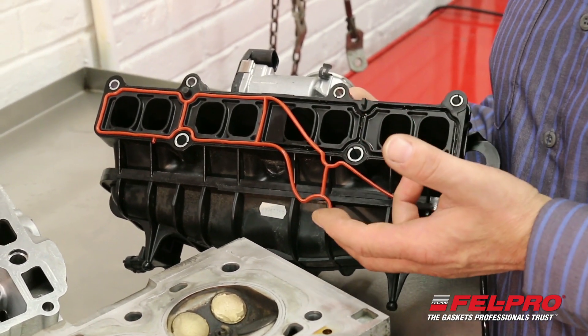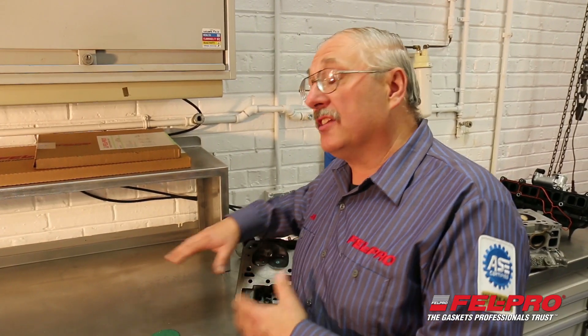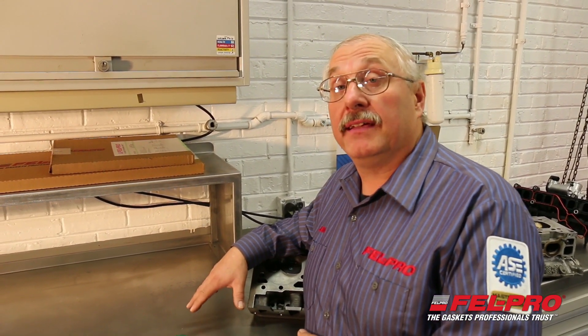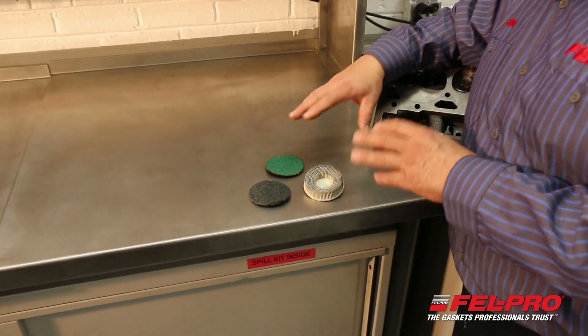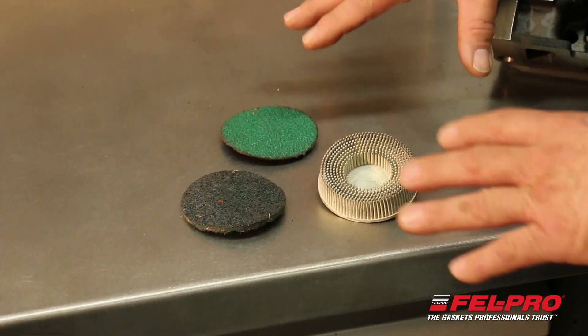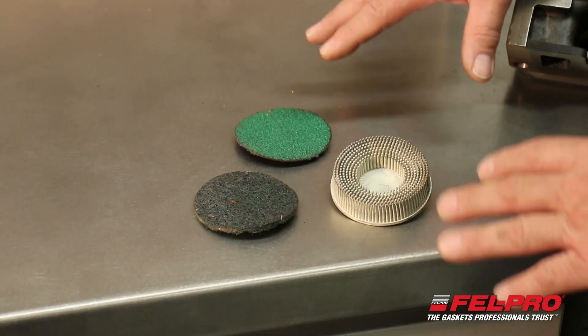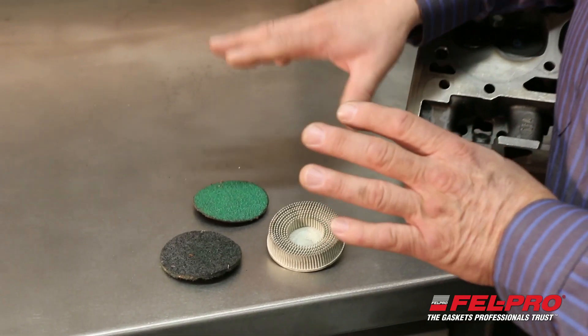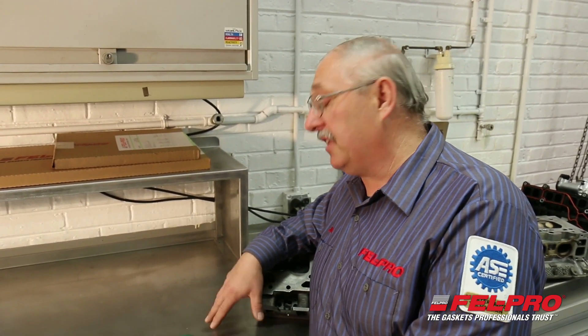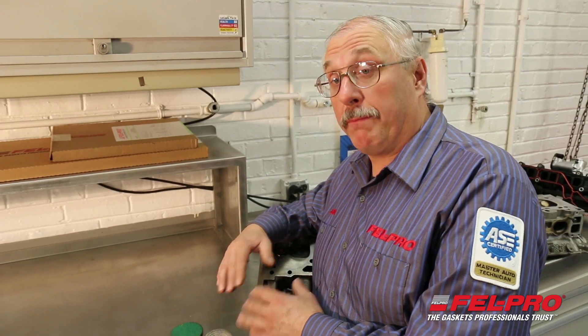Now that I've talked about the various ways of cleaning the sealing surfaces and the tools that I like to use, I'm going to talk about tools that you should never ever use — and that's these three items right here. These particular tools are great for removing rust and dirt and crud in a very short amount of time, but they will damage the sealing surfaces and create waviness and havoc. They might seem great because they clean things up quickly, but they're going to damage the sealing surfaces and either require you to send them out to a machine shop to get them repaired, or they're going to destroy the casting and you'll have to buy a new one.